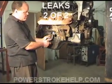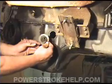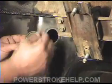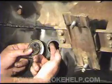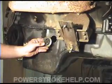This is the insert for the dipstick. This piece actually rides on the inside of the pan. It's on the passenger side, just behind the motor mount, and your dipstick tube comes down through the manifold and plugs in here. There's an O-ring that rides in this groove from the inside. What happens is the O-ring will swell over time from the heat and the chemicals and whatnot.